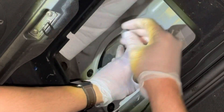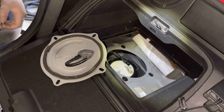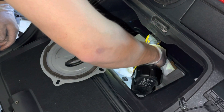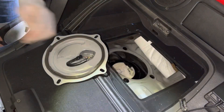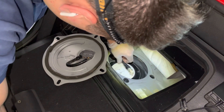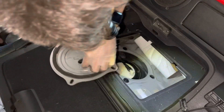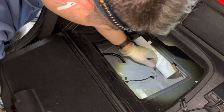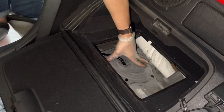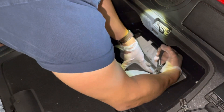We got it on there — then we have six little bolts which are holding it in place. I've got all of those bolts on there, now we're just gonna tighten them up a little bit — just slightly, don't overdo it because you don't want to strip it. Right now we're gonna snap the fuel line back on, and somewhere here is the wire connector — it just snaps on like this. Then I'm gonna put this cover back on here. The pliers — twist, twist, twist — both those things back how they were.